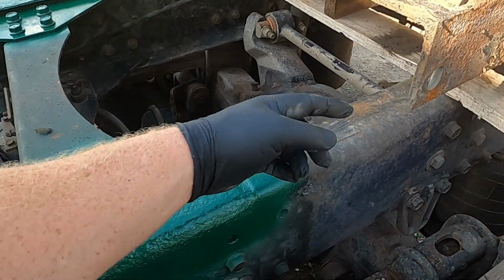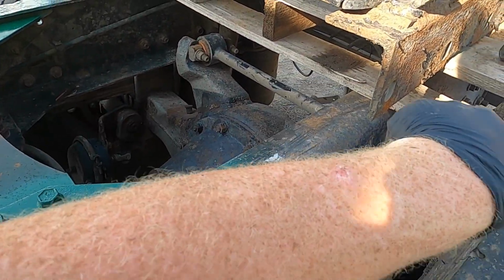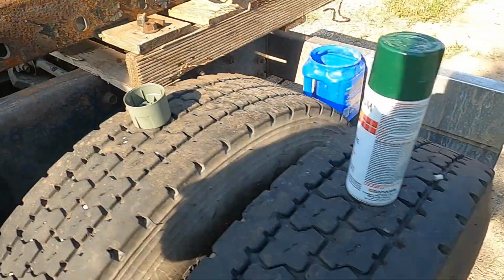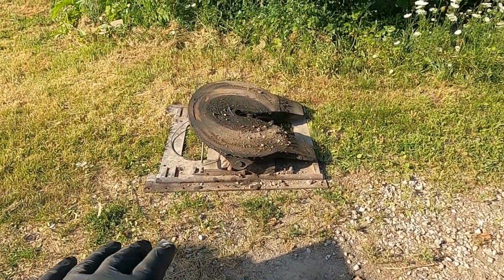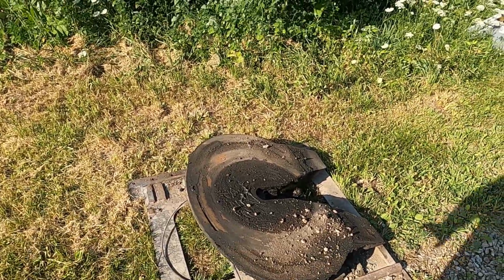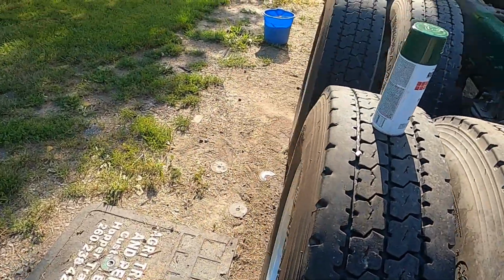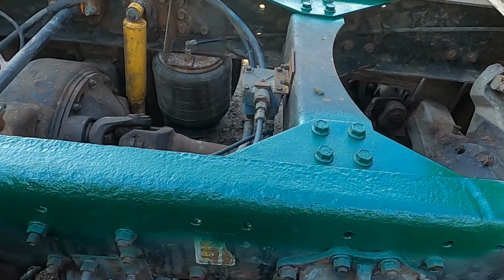So this is an inboard style. You can see it's got angle irons flipped the other way. This just slides down over the frame and gets bolted through it. I think the reasoning behind that other style, you see them on a lot of fleet trucks and on these non-serviceable fifth wheels. When that thing is worn out, you just unbolt it from that angle iron, drop another one on and bolt it back down. You don't have to get into the channel of the frame to loosen the bolts up. So a lot quicker to swap that out.